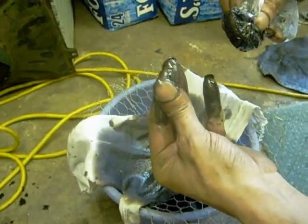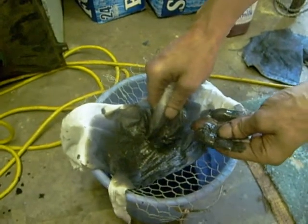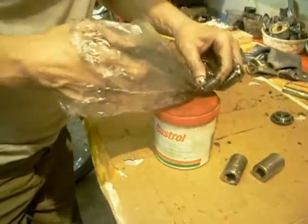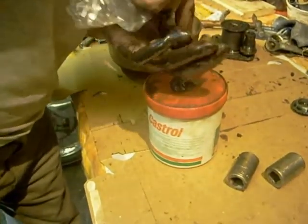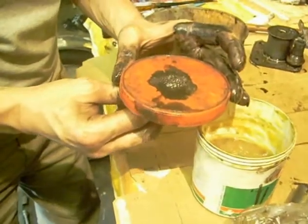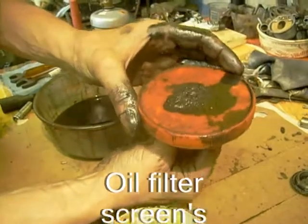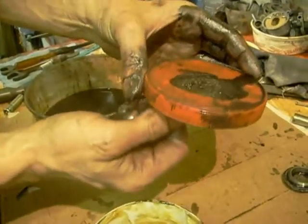Someone's wearing cams, because it's starting to rattle. I've got a set of cams to go in it, so there's plenty of steel in it. I'll put that to one side just to check - yeah, definitely steel. I'll take the magnet out of the bag - that should come off fairly easy. There we have it - that's come off the engine. So it's come off the cams and crank. I'll have to do my sludge trap.